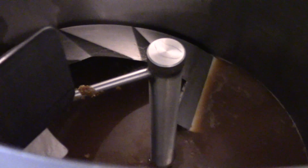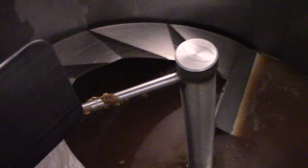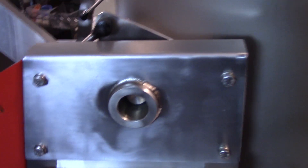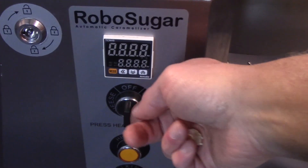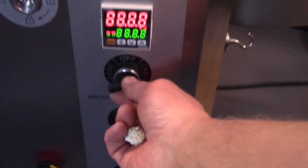I'm going to pull off the kettle lid. This is what the kettle looks like after adding water and just letting the system sort of clean itself. You get a little bit of scrap there, but I ended this process early so I could make the video. Ordinarily, I let the full machine cool down overnight — I just walk away from it — and you won't even have that little scrap on the bar. Everything will fall off into the mix by the time it all cools. The question comes up: how do you get the water out? You turn the machine off, then turn it back on while holding down the heating button for a couple of seconds, and these three lights start flashing — they now become controllers for the kettle.